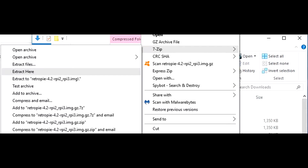After you download that file, find the location where you saved it — your desktop, downloads folder, wherever. You want to right-click that file, and this is where 7-zip comes into play. Once you right-click that file, click 7-zip and then under 7-zip click Extract Here. What that's going to do is create an image file, which you're going to use to write the image to your SD card.